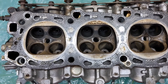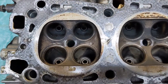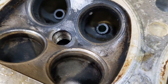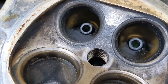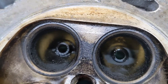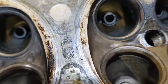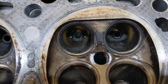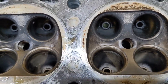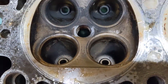Let's take a quick look at the head. If we flip it over, what we can see is again there's a lot of carbon buildup on the intake side. The exhaust side doesn't seem too bad, but there is definitely some really heavy buildup on the intake side. This leads me to believe that a lot of the problems are coming from those valve seals leaking oil down in and causing all sorts of problems. So I'm definitely going to go ahead and put those on the list of parts to order. Let's go get the other side, disassemble it, and see how that one looks.